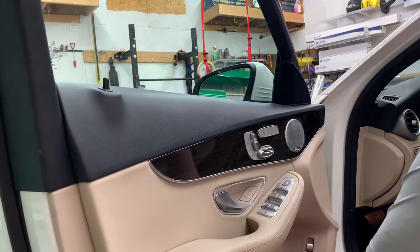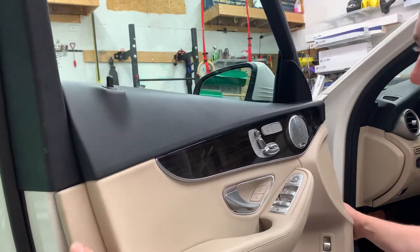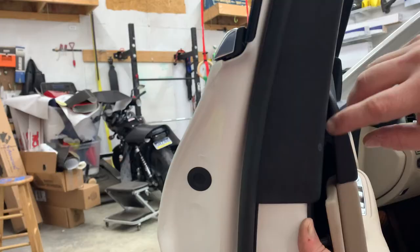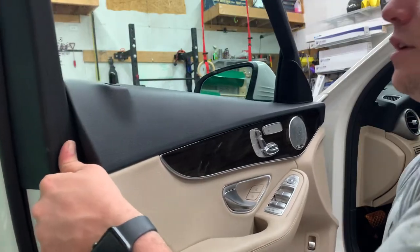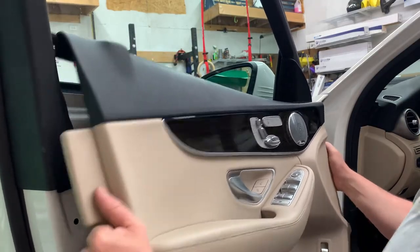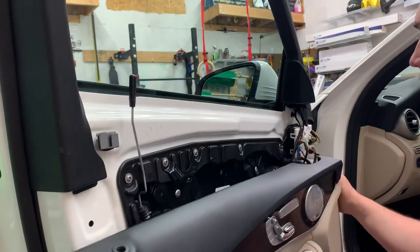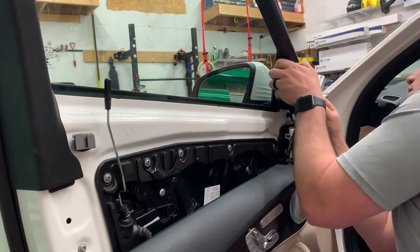Grab the bottom corner here — for all the rest of the door panels in this world, not all of them but most, work your way up the sides. Now, there is a clip on the back side here — there's a little white clip there. It's actually easier to slide that one up off. So we're actually going to slide it up out of it, and then slide the door panel back. What you're fighting against is the little tweeter up here. So slide it forward, you'll see it rotate, and then that comes right off of there.